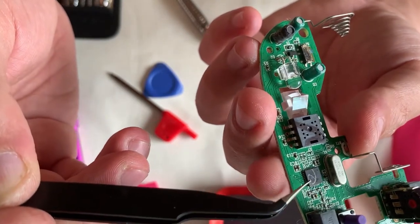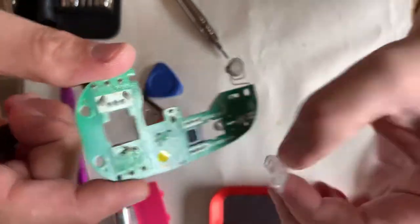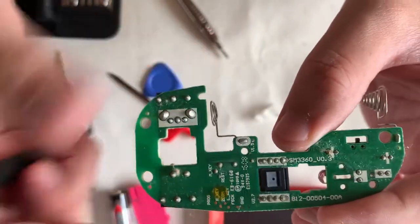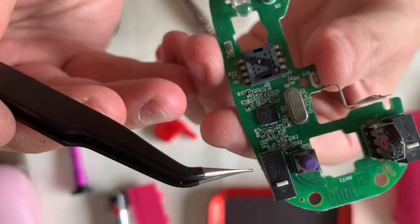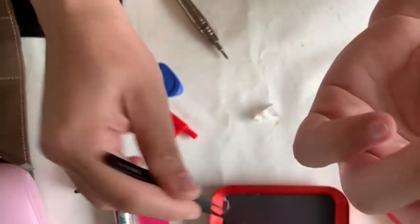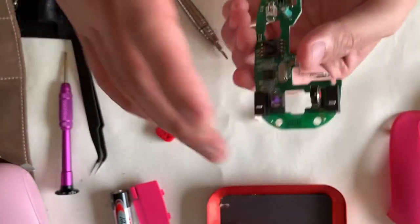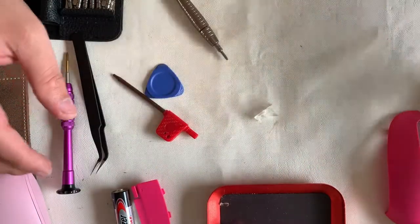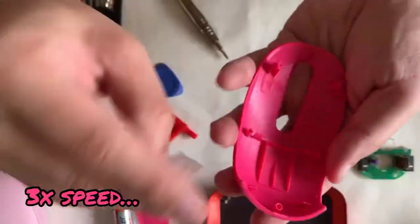Back to the PCB board, we have some standard parts — the prism, the IC, the sensors. It is a basic mouse, and with some use you'll find dirt inside because mice are not IP-rated or waterproof. The scroll wheel is the main point of entry for dirt. The switches are Kailh switches, quite standard for a basic mouse. If they've exceeded their lifespan, replacements are easy to find, and if you're hands-on with the right tools, you can desolder and solder new ones. Next, we'll move on to cleaning the exterior and interior of the PCB board.